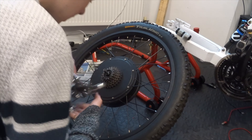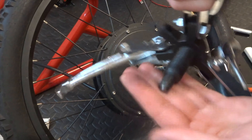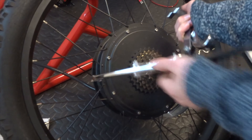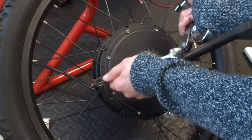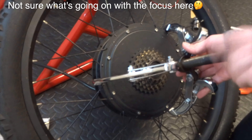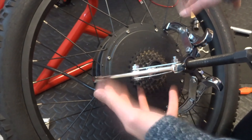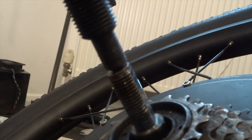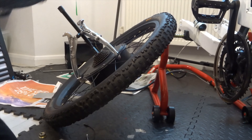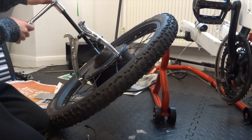The way it works is that this part goes over - there's a little dimple in the axle and a point at the end of the puller, so those two go together like so. Then the arms just fit around the motor underneath this ledge here, evenly spread around. You want to start tightening the puller just so it grips hand tight and it should stay there. You want the arms to be in between where the two bodies meet where the spokes attach, and the central bit resting in the middle of the shaft. At this point you get an 18mm socket and start turning clockwise.